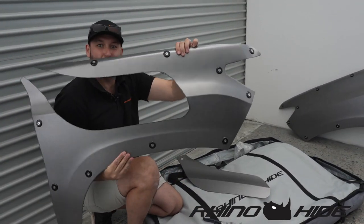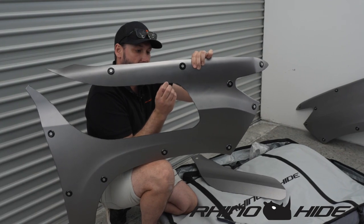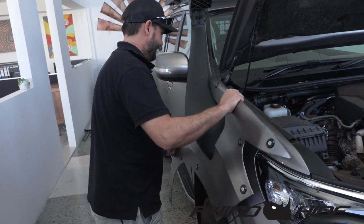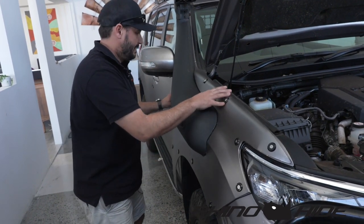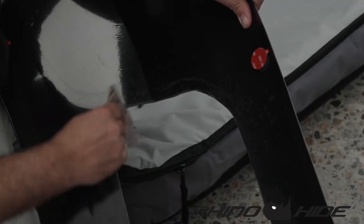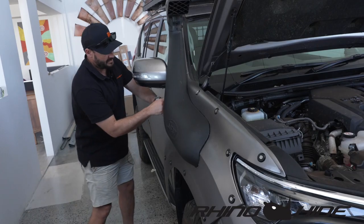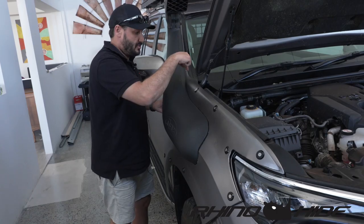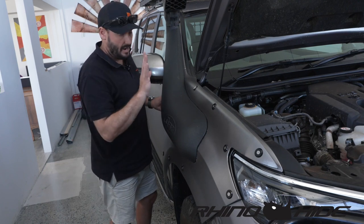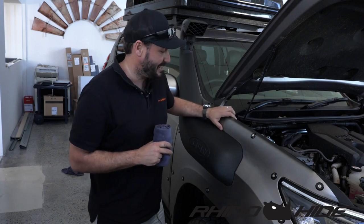There we have it — the snorkel cutout. I've gone really tight against there, and on the radiuses I've come in quite tight, and we can come through here with the snips again and make any more space we need once we've tried a test fit on the car itself. And look at that — that's actually pretty much spot on first go. I'm just going to get some sandpaper in here and neaten up the edges so it's nice and smooth. I'm going to put an extra arm lock up here on the top edge to hold that down because it doesn't have the meat through there anymore, and also underneath behind here I'm going to put one extra arm lock there as well — that's as simple as drilling a 21mm hole. If you need additional arm locks, we've got the spare parts on our website. She's pretty much good to go — we just need to wait 24 hours for the bases to cure and then Chris can take the car back out in the bush.